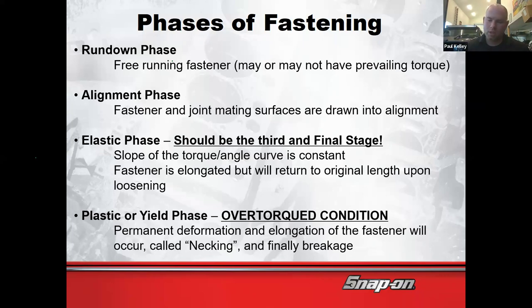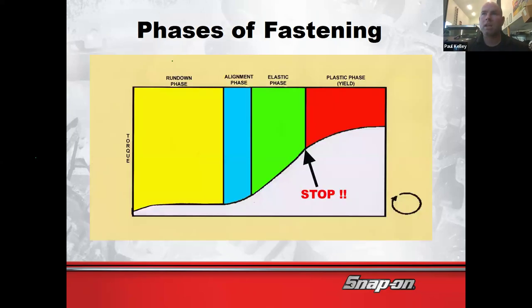And remember, we talked about it. If it's aluminum, the bolt's probably not going to be damaged. The aluminum is going to be damaged. So if that bolt is threaded into a caliper, like, for example, a brake flex hose, you just damaged the caliper. That could be expensive. If it's the brake lines or the power steering lines going into a power steering rack, that could be expensive. The rack's aluminum, etc. So watch these. Now let's run through the torque.